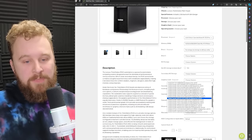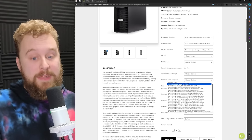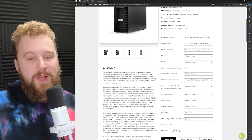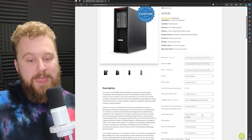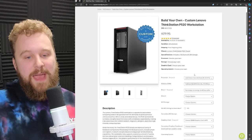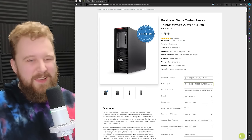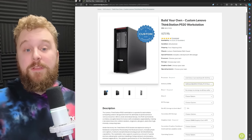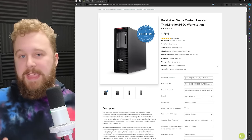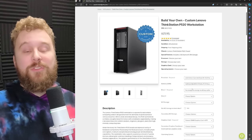They have a couple of graphics card options — most are Quadro cards, which for gamers don't really mean much. I'd recommend just getting the generic graphics card they offer for $5. I wish they gave a no-GPU option, but we'll grab the generic 128MB card they're probably trying to get rid of. You can pay for Windows through them, but you'll pay a lot for the license versus something like GVG Mall. If you're on a budget, just go GVG Mall. All in all, $179 gets you a Xeon and 16 gigs of RAM. The 10-core Xeon variant is a waste of money for gaming — it won't give more performance and you may actually lose a little due to slower clock speed.